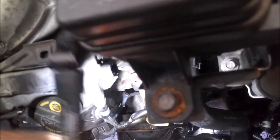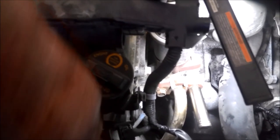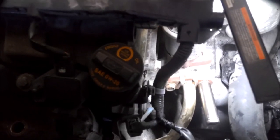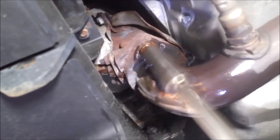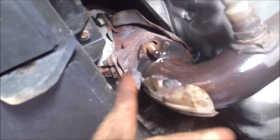Once you get the fans out, I'm going to go ahead and pull this O2 sensor out — it's easier to get leverage on it to loosen it while the manifold still holds it. I'll crack that loose and get it out. Then we'll hit these two 12mm bolts right here on the air tube — it's hard to get to with the brace in the way. You got to remove those before you remove the catalytic converter. You got the three bolts underneath here — I've already soaked those down and broke them loose — go ahead and run those three off and then you should be done underneath here. Just run these three off and then we can go to the top and pull this thing out.